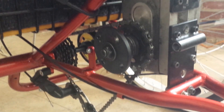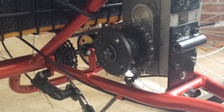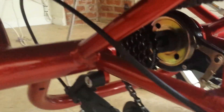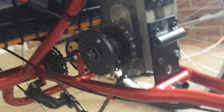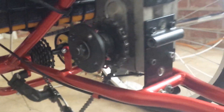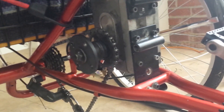Right now we don't have the front sprocket hooked up, but we have it hooked up in the back. This motor actually came off the red recumbent trike that I built — we're doing a motor upgrade on that one. We have a sprocket that goes down to the derailleur and a seven-speed cassette on the back. I'm using a much smaller gear than on the recumbent trike; the gearing gets you from about five miles an hour in first gear up to about 13 to 15 miles an hour in seventh gear.